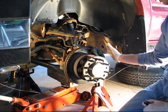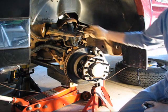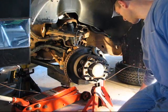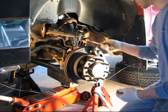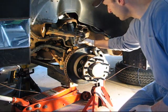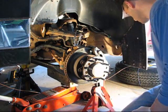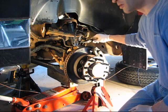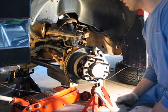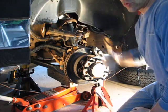We have a couple of jack stands in place just to keep everything stable. You still have your brake lines and anti-lock brake harness all connected here. There's a 19 millimeter bolt on the bottom of this upper control arm assembly — use a regular box wrench and back it off. Make sure you have your jack stands in place. Use a pickle fork from the side with a hammer and it takes it right out — very basic. We're just going to remove this other brake fluid line and move forward with swapping out the upper control arm for the Cognito unit.